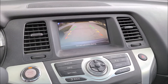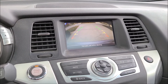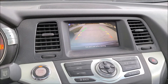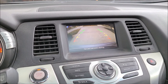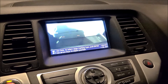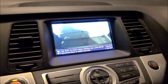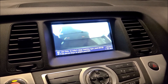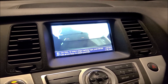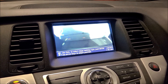We're ready to test the new control unit — put it in reverse, and so far so good. We'll monitor it for a week or two since it was sometimes black and sometimes functional. After running for the last few days with no issues on the backup camera — longer than ever before — it's safe to call this a success. In this case it was the camera control unit that had to be replaced, likely a bad capacitor on the board. Hopefully this video helps somebody fix a similar issue.